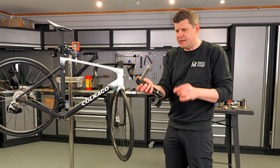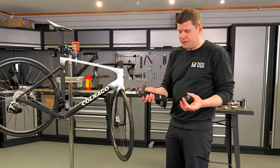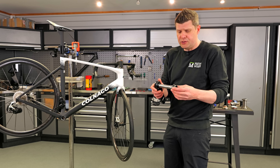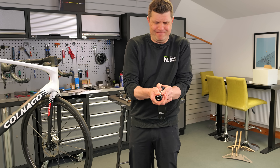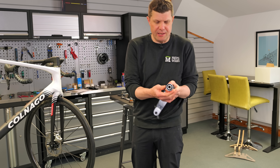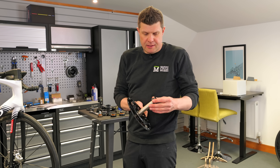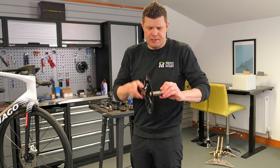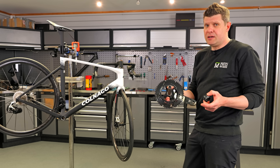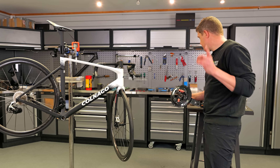The other problem is the Seabree crankset. This should be a 24mm shell, and one simple test: is it actually a good fit with those Dura-Ace bearings? You can see how tight that is to get on — it does go, but it is tight. Now the Shimano Dura-Ace crankset and bearings — look how easy that went on and spins significantly better. You don't need a micrometer to tell you there's some sort of tolerance issue going on, but I do have a micrometer.